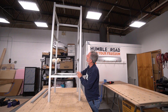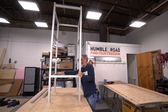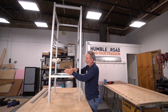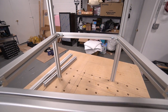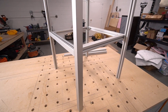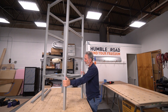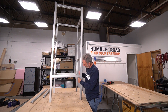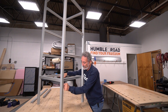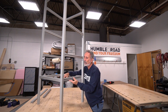I can't wait to put this in. I've got these two runners — or sleds — and these are where the refrigerator feet sit. When you put the fridge on the ledge and push it in, it slides right down on these two sleds. They're inboard of the frame because the feet have to slide on them; my other supports are outboard. Once we determine the actual height of the fridge, I come in and put a secondary leg on each of those sleds, taking that weight right down to the floor rather than hanging it on brackets.